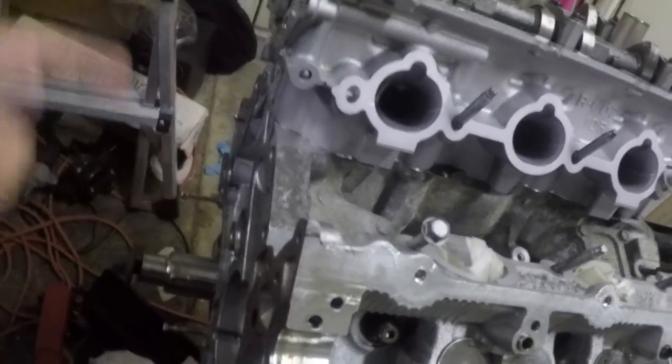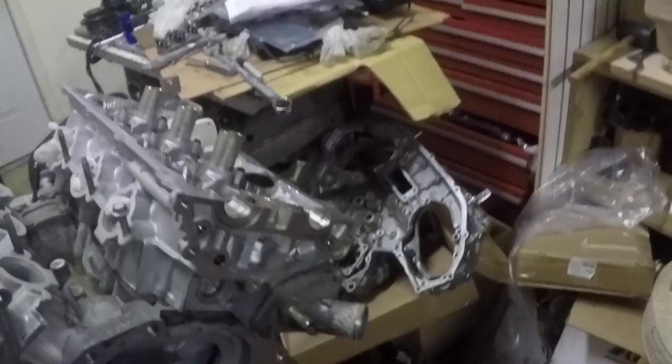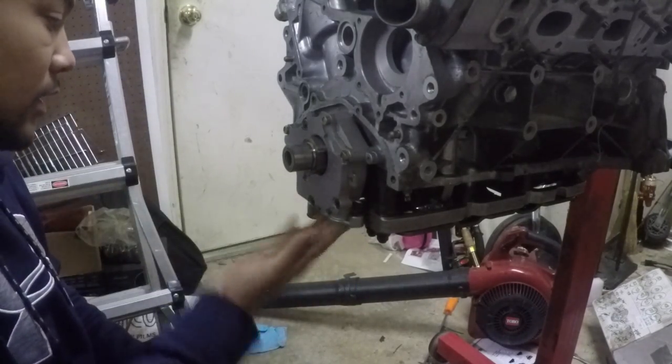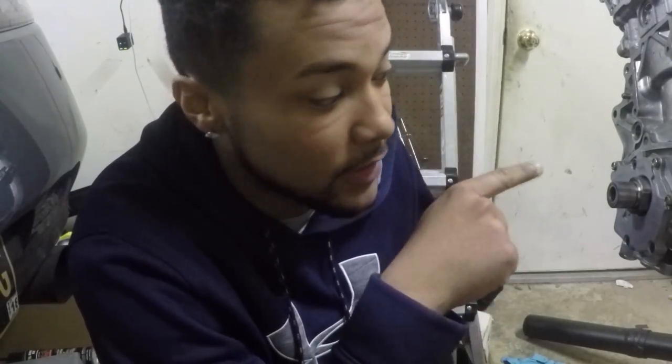In the next video those should be here along with the cam gears. I also ordered new timing chains and tensioners because my old tensioners had metal shavings in them — I did not want that. One complete head is done. I still need to pull the sides off, put the tensioner in, and put it back on. The oil pump is now on. I'm not putting on the slurp tube because I don't want it hanging low hitting anything right now.